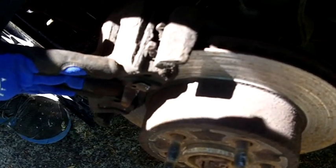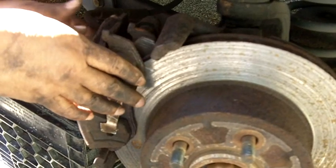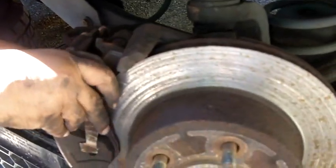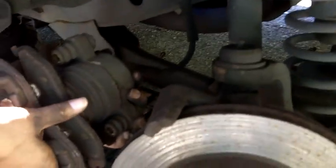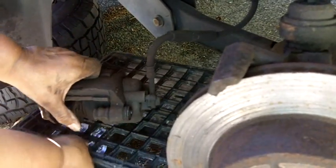It's time to take off the caliper. You always want to make certain that you have a bucket or a crate nearby to rest your caliper on — you don't want to put tension on the brake line. I've just got it almost clear of the rotor. Your caliper isn't always going to slide off real easy; I had to pry it off a little bit. So if you meet resistance, don't think it's anything extraordinary — it can be typical. There we go, that's all it takes. I want to be very careful of my brake line, so I'm going to set the caliper down carefully.